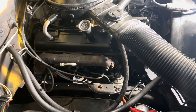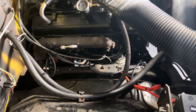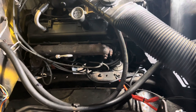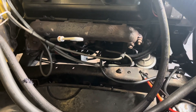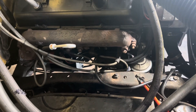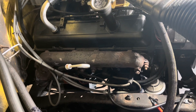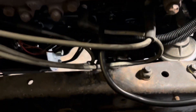So I replaced the starter, replaced the battery — things were pretty good, turned over a little bit faster. Months go by, I take it to the dump and again slow starting, almost not starting, very slow turning over. The battery was good, the starter was good. I took the battery back in and they can do a heavy-duty test of each cell at your local O'Reilly's, and the battery is fine.